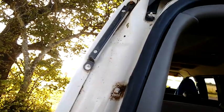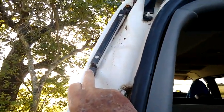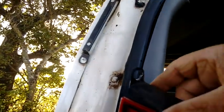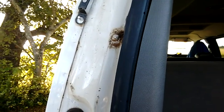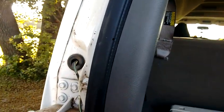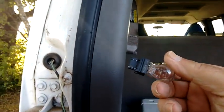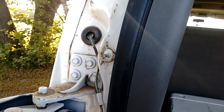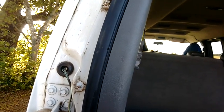After you do that, this one bolt here has to come off because this light — the top lens — has to go there. The bulb is the bayonet type. The common 3157 is the one that went out. It's the signal light and it's also the one that flashes when you use your key fob to open and lock the door.